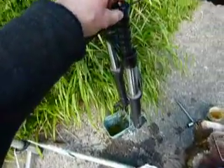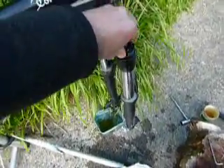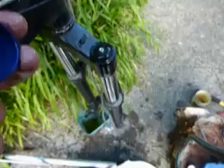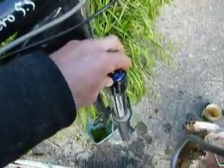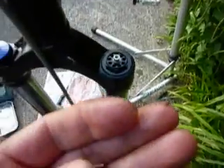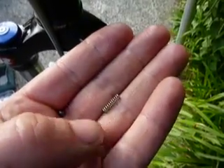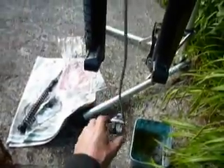Back in with the compression cartridge — tighten that down, and the knob goes on and is screwed down. On this side you've got the spring and the ball bush bearing to put in, so put them in the three holes with just a dab of grease in them, and the top goes back on like so. And it's all ready to rock.